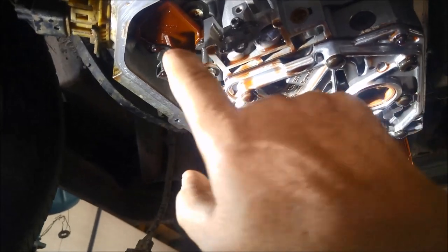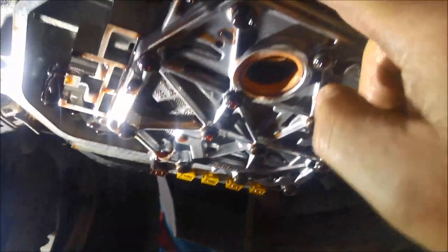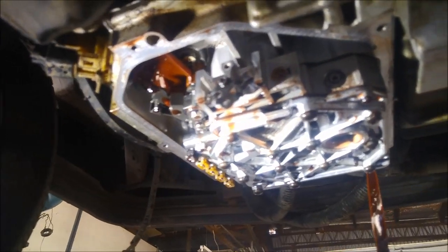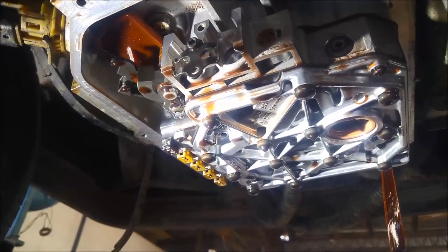The Sonnax site — S-O-N-N-A-X — has sealed plugs with a little o-ring on them. Sometimes these end plugs at the front will leak, so you can get an improvement kit to fix these. But these valve bodies are pretty prone to wearing out as well, so you need to do a vacuum test on all the little valve channels.